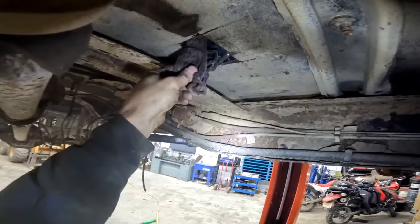What it's designed to do is when you go around a corner to the left, the tire on the inside will spin less than the tire on the outside. Someone took a lot of engineering and fiddling to make this thing work, and you're adding weld to it. You're messing it up anyway. So if you're going to be welding your diff, weld everything to everything. As long as you don't incorporate the crown and the pinion and the axles, you're good to go.